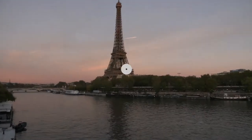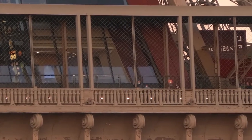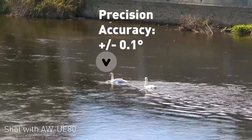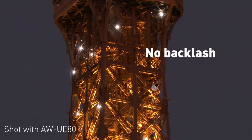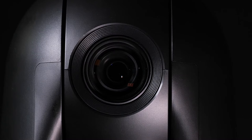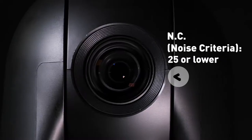As a bonus, we can apply intelligent zoom to achieve up to 36x zoom. Panasonic is proud to introduce a new direct drive system in its PTZ range. Direct drive motors have a major advantage over traditional gear systems when it comes to increased positional speed and dynamic accuracy, because there is no backlash or lost motion in any direction of movement. In addition, it achieves an operating sound of NC25, so this PTZ can be installed and used at any video shooting site where quiet operation is a must.